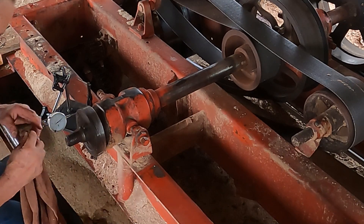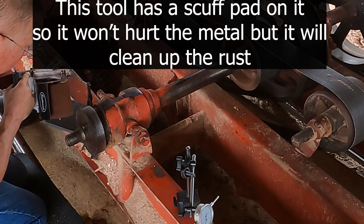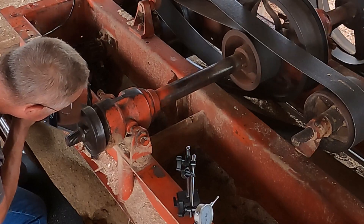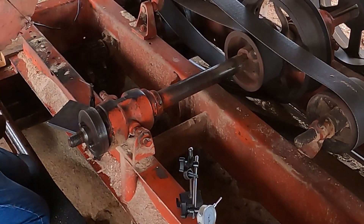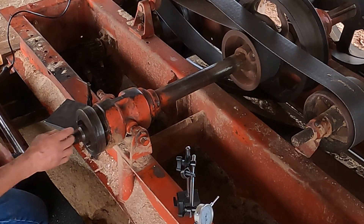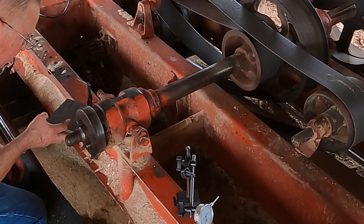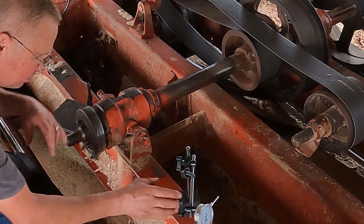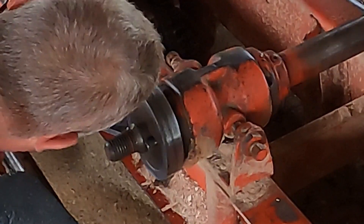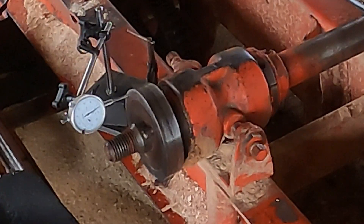Let me make sure there's nothing on here, because this has got some stuff on it. These are plastic scrapers and I use them on cars all the time — that's how you clean gasket surfaces. It's pretty hard to do anything bad. There's a little scratch in here, but let's put this back and see what she does. Go ahead and spin it again. The good news is it didn't fix it — it's still five thousandths.